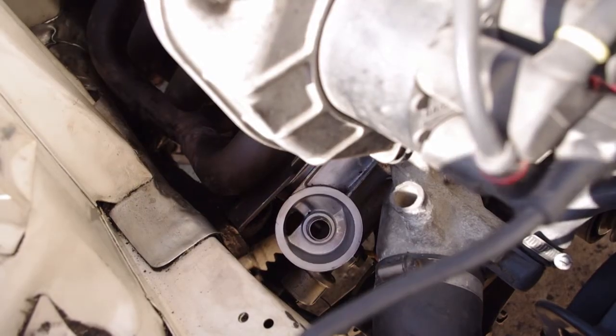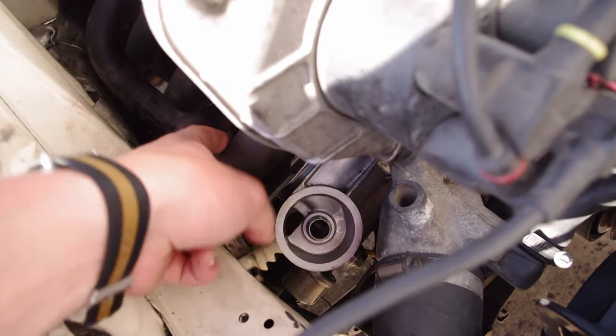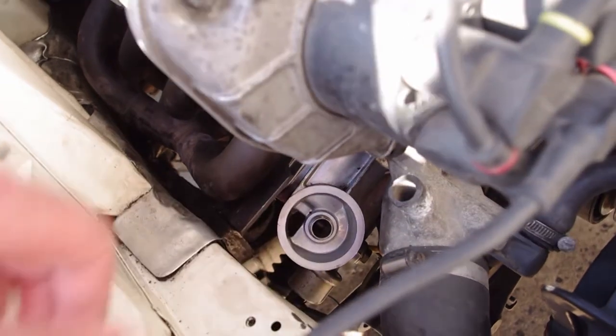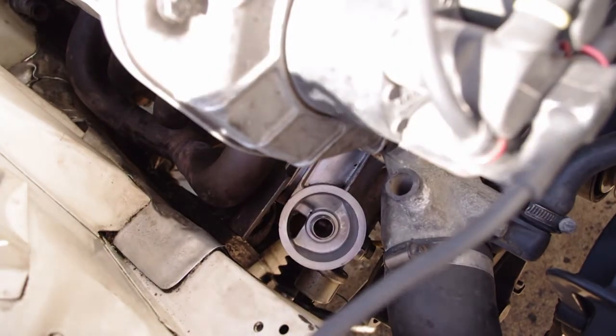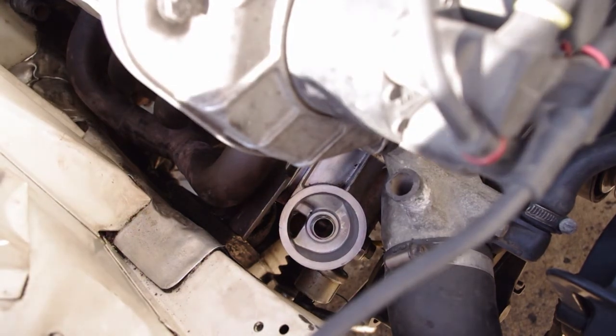All right, so after I tapped that one out, I just put the bolt in and then mounted this shield here, put the headers back on, and now you can see I've got this cleaned up mounting for the oil filter. I'm going to put that on, put a little bit of oil around the surface of it, then fill up my engine with oil, run it for a minute or so, drain it out to get all that crap oil out of there, and refill it.